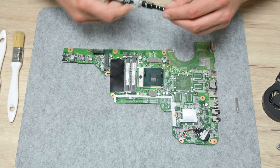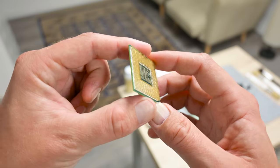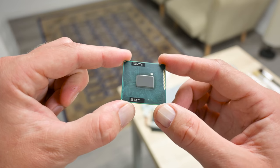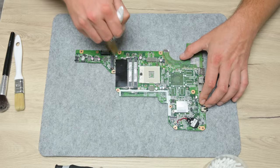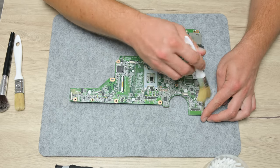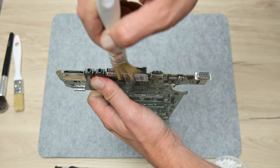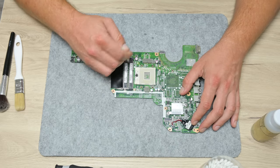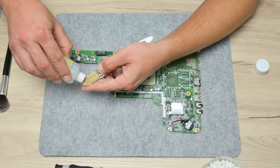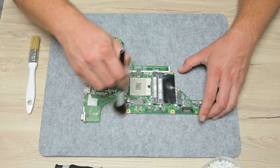A removable CPU is something really missing from newer laptop models — it was a great option for upgrade flexibility. Now I move to clean the whole motherboard. To clean it I used 96% isopropyl alcohol, a few soft brushes, and cotton buds. The motherboard has very little dust and dirt on it, but while cleaning I also inspect the motherboard components and ports in case I need to do additional repairs or replace something. It's better to check everything before continuing to the next parts.